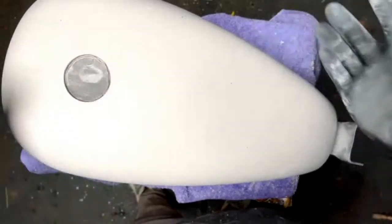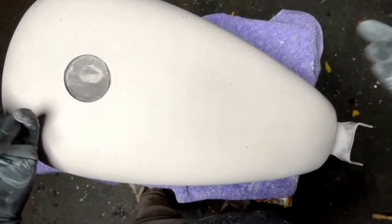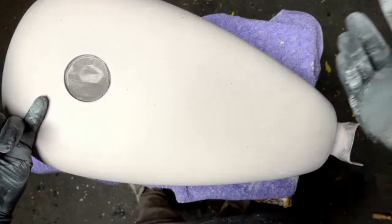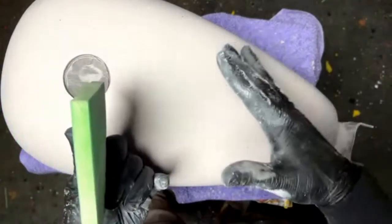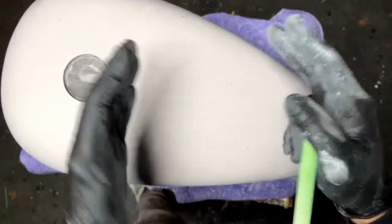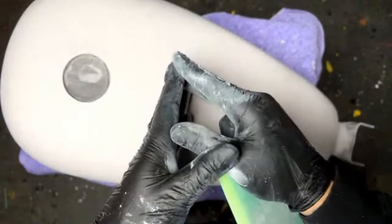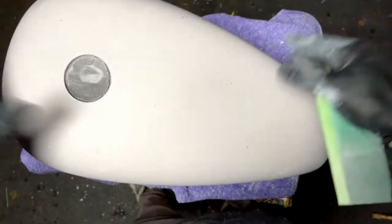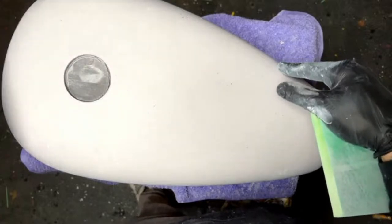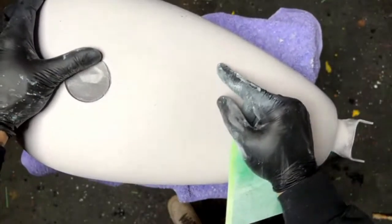On a wet-on-wet, like we talked about earlier, doing a sealer, and then you're letting it flash off, and then go straight into base coat, well, that's a chemical adhesion because we're not scuffing the primer sealer. We are just applying it right on top while there is a small window of time that allows you to recoat that, and it will chemically bond and adhere to the primer. But like I said, these are sandable, so they have to dry, because obviously we're not sanding them while they're wet. And while sanding it, we are creating the mechanical adhesion for the next layers to grab onto. So hopefully that makes sense.